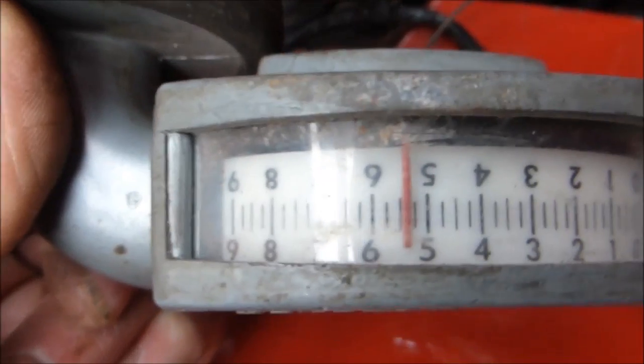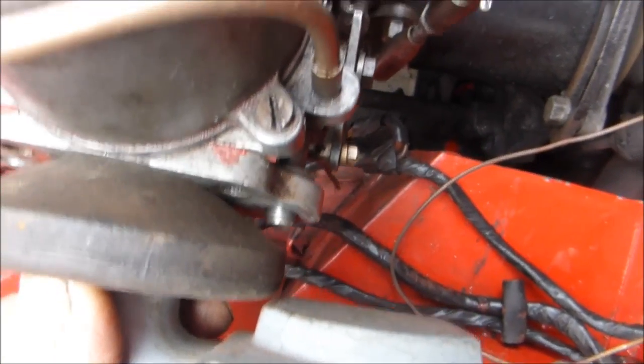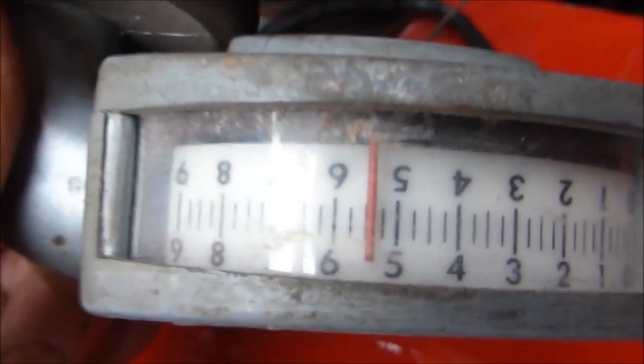The second carb is slightly lower, so just tweak it. I need two hands but I'll just increase the speed on this side. It's not too bad, it's nearly there — just one notch. Have a look, check this again.